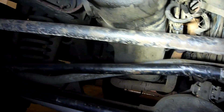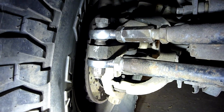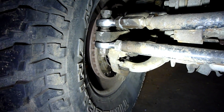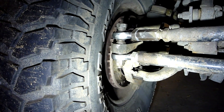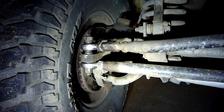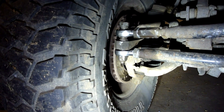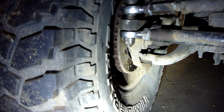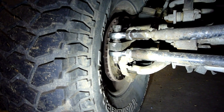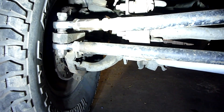At this end, as you can see, I've got the drag link on top and the tie rod on the bottom — same knuckle apparatus. This just bolts right on. I had to drill out the taper in the knuckles and run a straight bolt through. I went through a couple of different modifications: I had a smaller bolt through there — I think 9/16ths — and then I wanted to upgrade, so I went to 5/8ths with those heim joints.